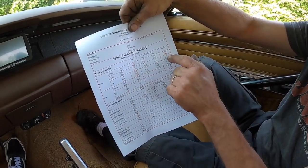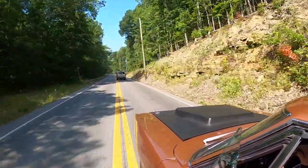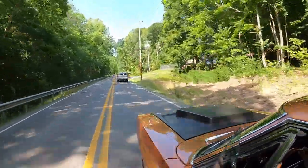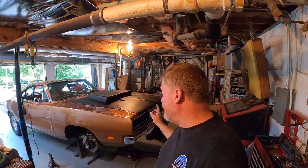So we need to come back with some adjustable strut rods, and then I can really dial this in a lot better — I can move just the caster and leave the camber alone. We got our marching orders. As Robert explained, our alignment is just a little bit off, and the way we're going to amend that is by using a new set of adjustable strut rods to get that unibody squared up again. It's a 54-year-old car, so there's going to be a little weakness and some compensation needed.